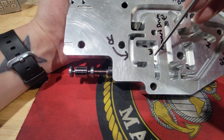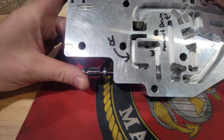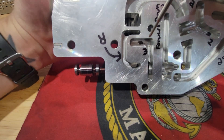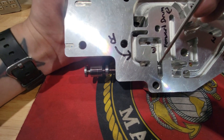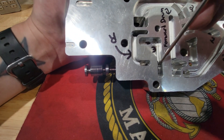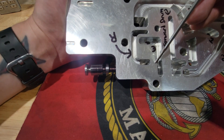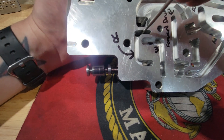When we go into reverse, we'll move the manual valve to the approximate location. Now we're in reverse — we're taking mainline pressure down to the manual valve. The way the manual valve is designed, it will not let fluid go this way, but it will let fluid go into this cavity here.